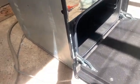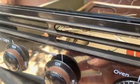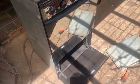Now the only problem with this, I see, is that bloody solenoid. So to work the griller, I had to put that pin back in the solenoid, so the gas to the oven wasn't going on. So the pin's back in there to stop gas in here. Well, this can be controlled by the knob here. So if I had a better oven to show you, I would, but the concept's there and it does work with biogas. You just have to, same deal, restriction nozzles.